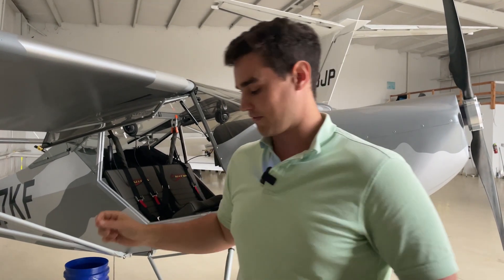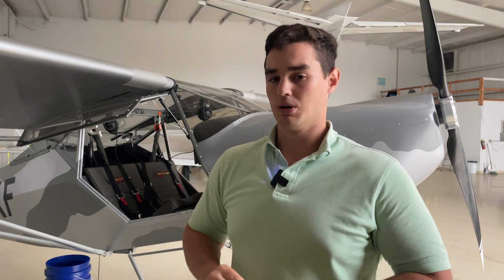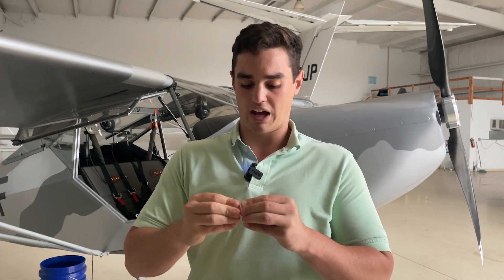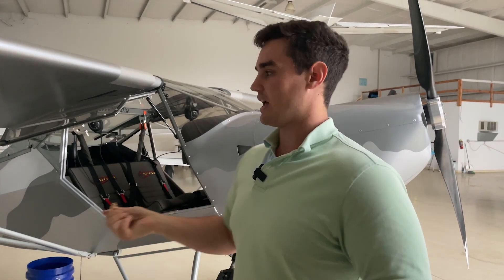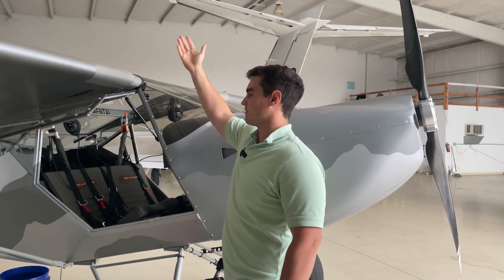In order to fold a wing, the first thing you have to do is drain the fuel out. I have drained the fuel out of the tanks before — it's a huge pain with the equipment that Kit Fox provides. The drain valve is not very drain-friendly, so you have to manually hold it down and it just makes a mess and spills everywhere. I'm going to replace my quick drain valve, and I'll start the timer after I get this in. If you're going to regularly fold your wings, you'd have to have some form of quick drain or locking drain valve.